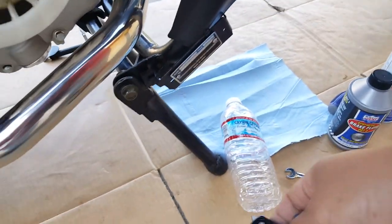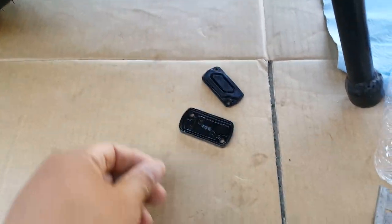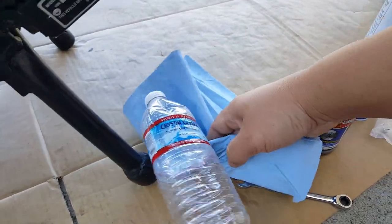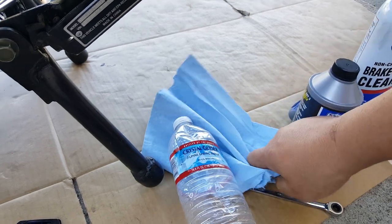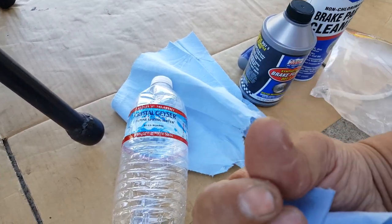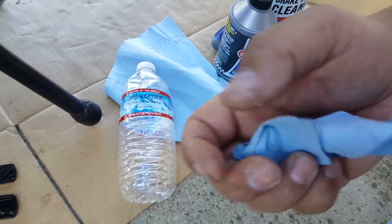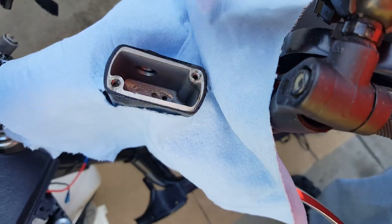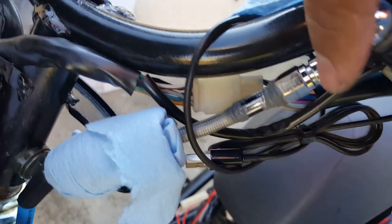I've got cardboard ready this time and a little more prep. We're going to get the plastic cap as well — it's already on there. Keep the bolts here, and take a little piece of rag as a backup in case we need to wipe our hands. You can use gloves if you want less mess, because brake fluid is very harsh — it'll eat through everything including your skin. You'll probably even lose your fingerprints and won't be recognized on your phone anymore. We're going to stuff this in, clean out the rest of it, and inspect this JB Weld to see if it can hold. The minute I pour it in, we'll see what happens.